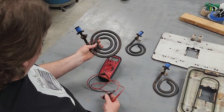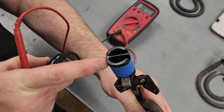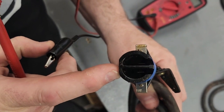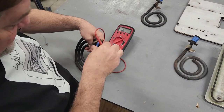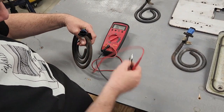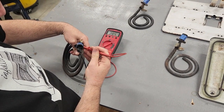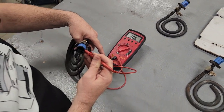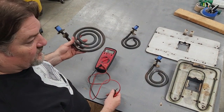This is an 8-inch infinite heat burner — maybe easier to see the terminals in this one. There are two little silver metal terminals down in the hole. Connect one side — it doesn't matter which side; you can connect to either terminal when measuring resistance. We'll connect this and make contact with our other probe. What have we got on our display? 20.7 ohms, which is about 20 ohms — that's about what you want the 8-inch infinite heat burner to read.